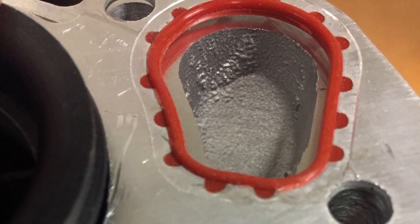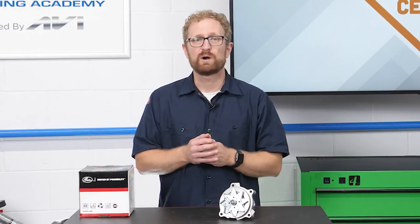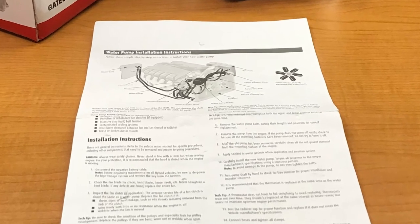Also, the added substance might not be chemically compatible with the new gasket. If a carrier style gasket requires a sealant, some will include a portion in the kit. Most replacement gasket manufacturers will include instructions for installation that will outline whether or not sealants need to be applied.